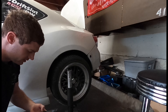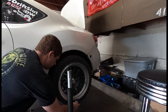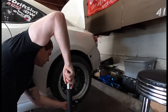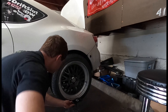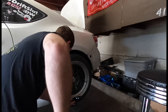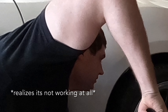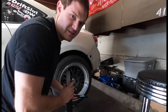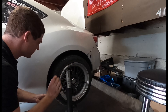Right now at droop it's sitting at about a degree of toe-in. As we go up it gets more drastic. It's a little hard to tell - I haven't tried measuring toe this way before, only the camber angle with more steering input. I'm just experimenting because I'm curious.